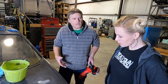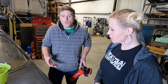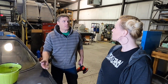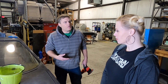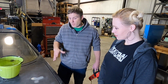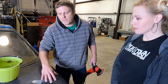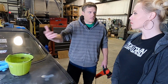Anytime you're going to repaint a car, if you don't blast it down to the bare steel or sand it down to the bare steel, you want to remove the crap paint. You want to get down to good paint. And usually the best base to do a car on is really a factory paint job, because it's already primed underneath, and you've got the factory paint, which should be a decent quality paint. Some of the Fox bodies in the 80s had bad paint jobs. They had recalls on them. But the biggest thing right here is we're trying to save the original paint, and that's why you're paying attention to that so much. Normally if you're just sanding it to repaint, you wouldn't pay that close of attention. But what we're trying to accomplish is different.